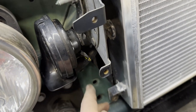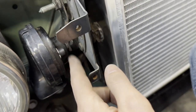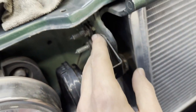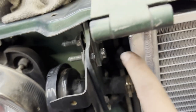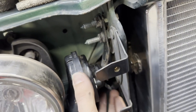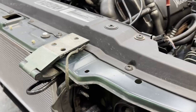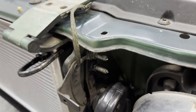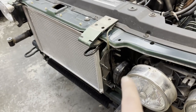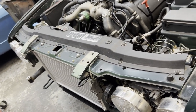We now have the horn installed. All I did was clean it up a little — the connectors were still sitting in situ so I plugged those back onto their spade connectors, then slipped this up over the studs, slid the nuts over, and tightened those down. The grounding strap is pinned in behind this nut where it came out from. This horn is connected and this side is now done — both hinges are in and we're essentially ready to move on to doing the fluids.